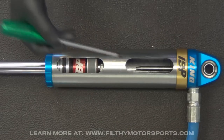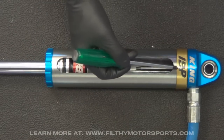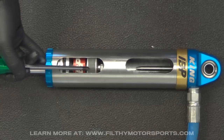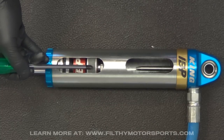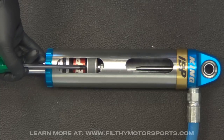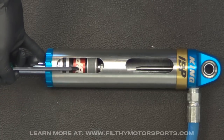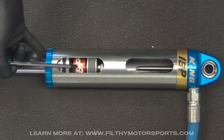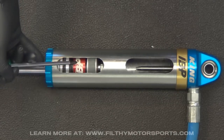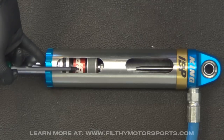The first thing you'll notice is there's a pin coming in from the top cap. This simply comes down through the center of the shock, and here we've got a piston like you would have in any other shock — this one has compression shims on the bottom and rebound shims on the top. Underneath that is the internal bypass pack, and again you've got another compression and another rebound shim in here. For simplicity, just look at it as two separate pistons.